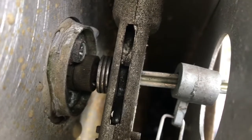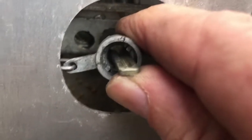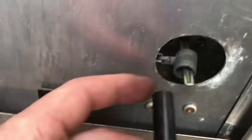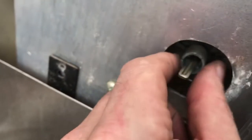That'll suction together, but you need to have a spacer between there to hold this little piece here, because what it does is it's got little splines inside of it. It's hard to see. Yeah, those little splines go into the back of this guy. That's the handle. So we got to cut a little piece of this DOT tubing. Cut a little piece of this DOT tubing you stick in there to shim that out. So what happens is that thing has an electric solenoid in it. It'll turn that thing, you know, and unlock or lock the door.